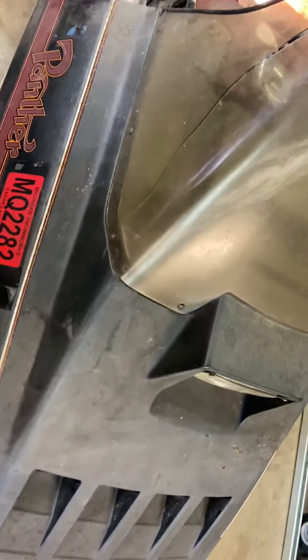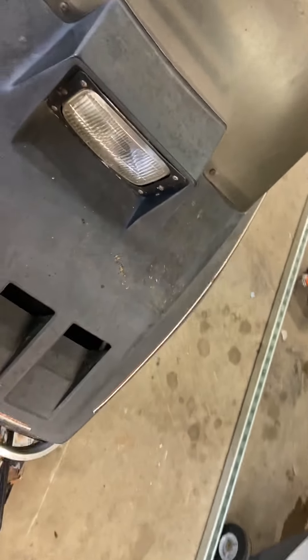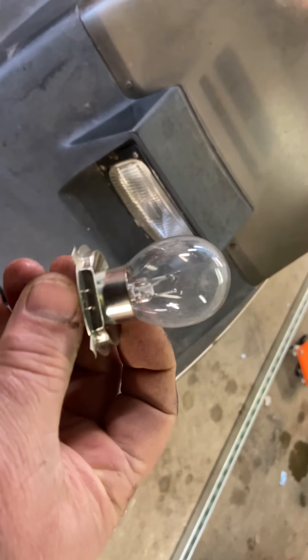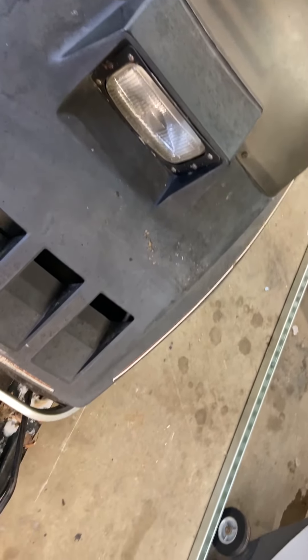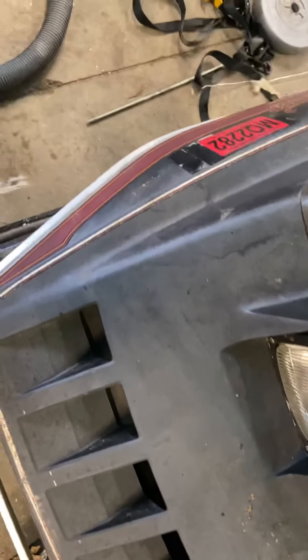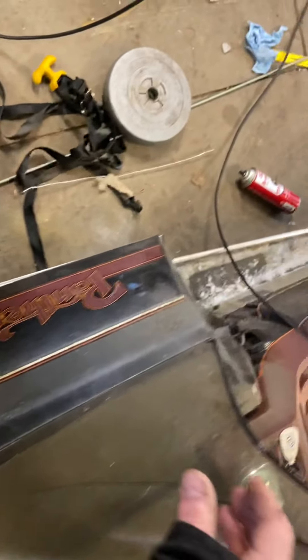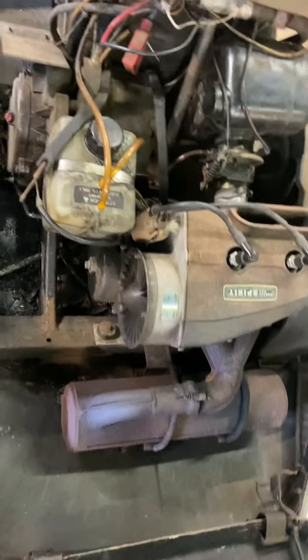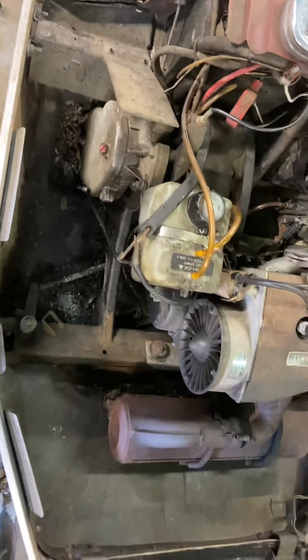So far I had to replace the hood. I'm going to have to put in the headlight — this is what was in it, you can see it's totally blown out. Put a new modern halogen version in, came right up, nothing to do there. The recoil starter doesn't want to recoil — that's what I'm going to look at first. It does start and does run; I was ripping around the yard in it already.